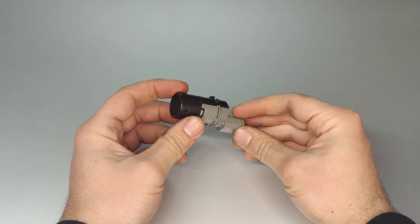So how do we find the bad sensor? Obviously, if you have a visual representation of your parking sensors, you can know very easily which one is bad. If you don't, then it's a bit more challenging, but it's not that hard. Next up is the diagnostic software where you can sometimes see faults for the parking controls, but that's not always the case. Sometimes the sensor itself can still be good and not giving you any errors, but it's just not giving you the correct signal.